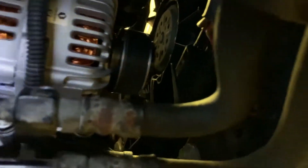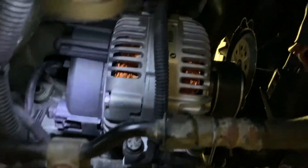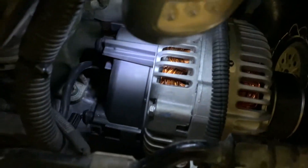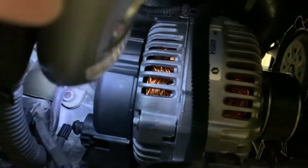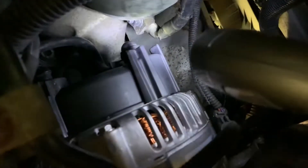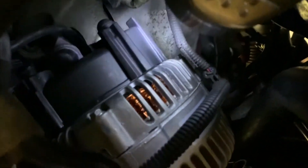There's another mount point — I put a zip tie there to keep it steady. You'll also see the field wire on the back of the alternator; disconnect that clip using a flat screwdriver to pry it out. The other connection is behind a plastic cap — there's a wire that goes from the starter solenoid to the back of the alternator. Pop that cap off; it's a 13 millimeter nut, but you can't get to it because the motor mount is right in the way. So what we did was take the four bolts off the alternator, turn the alternator sideways, and pull it out — then remove that 13mm nut once it was out of the car, just to make it easier.